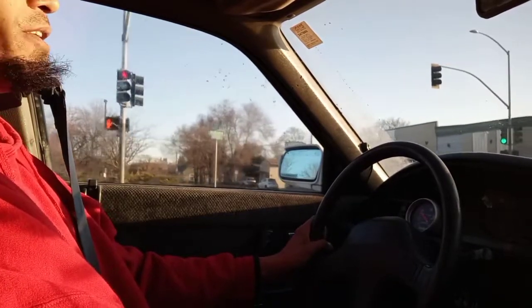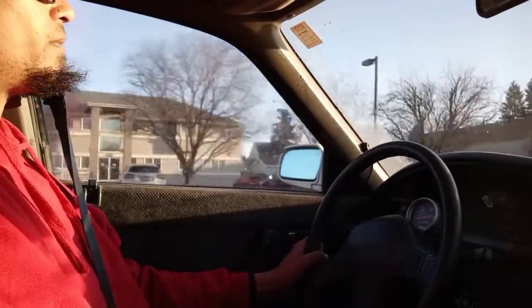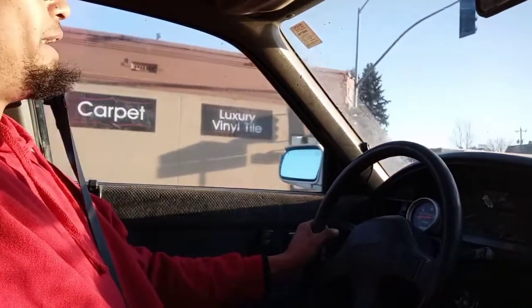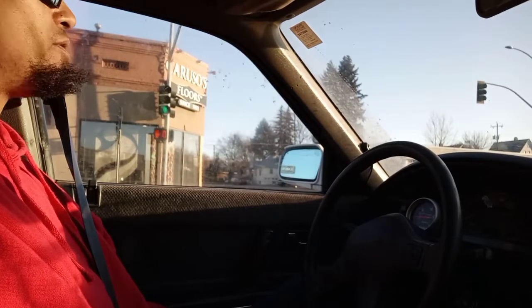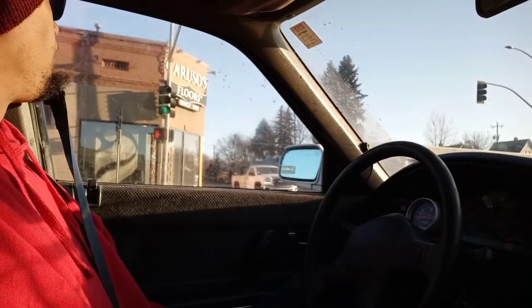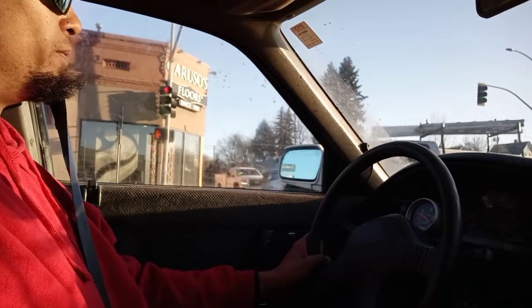For instance, I'm in second gear, hardly any throttle, 2000 RPM, and I plant it. It takes a second for the boost to kick in, right? But if I brake boost, then instead of the RPMs rising as the turbo comes into boost, you can get that turbo to produce the same boost without the RPMs rising. So when you let off your brakes, you have an engine under full load already, under full boost, where the load you already have is plenty to keep the turbo spooled at full boost so that you can keep going.